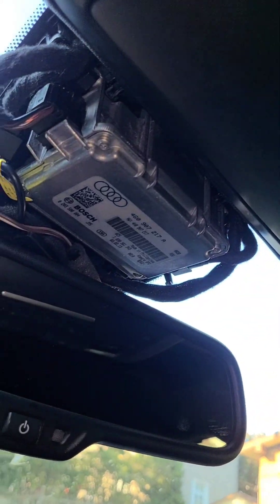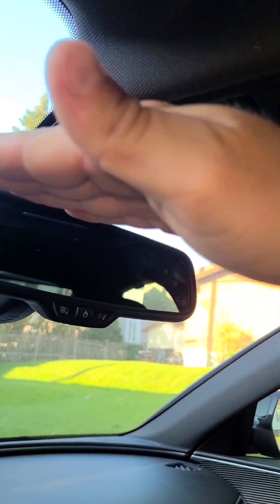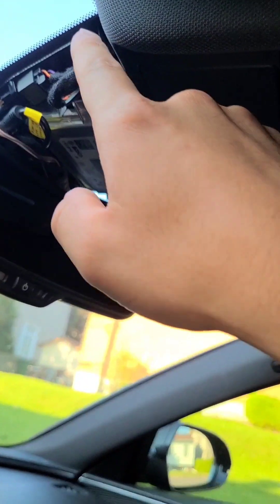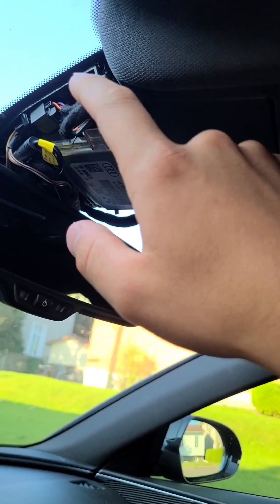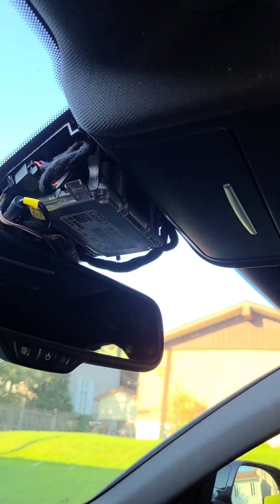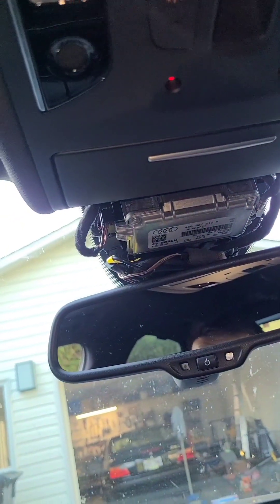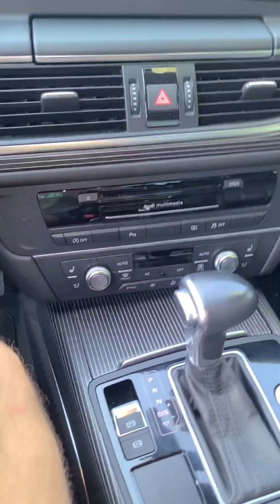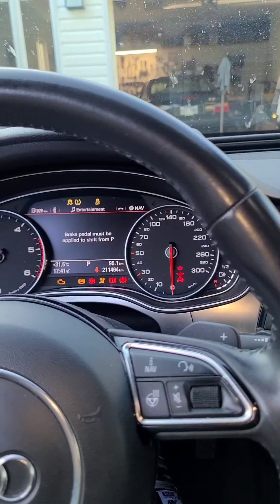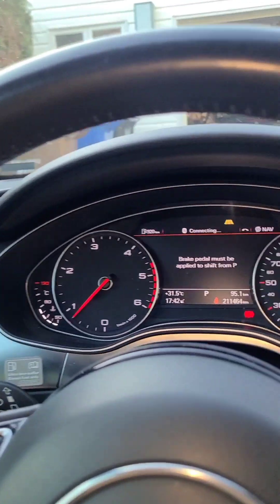I just put this back and plugged both ends. Something you're going to want to be careful with is the plastic — this is basically wedged in. It's kind of hard. It's basically wedged like that and then kind of clips in. You want to be very careful with that. You can pull on it pretty decently, but this plastic thing is glued to the windshield. The last thing you want is to rip the whole thing off the windshield because then you're going to have some bigger problems on your hands.